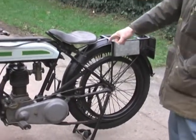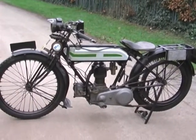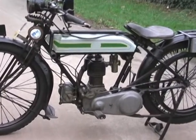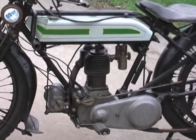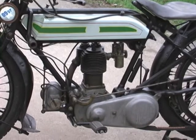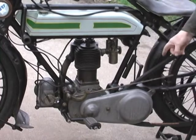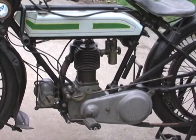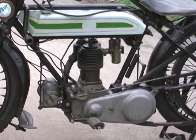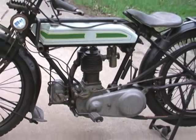The engine is a single cylinder 550cc — quite a powerful single cylinder engine. The carburetor is made by Triumph, which is typical to Triumphs with two bodies as against one. We've got an enclosed case covering from engine to clutch. Three-speed gearbox. Top speed is 45 miles an hour; sensible travelling speed would be 35 to 40.